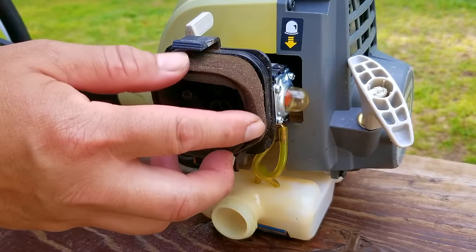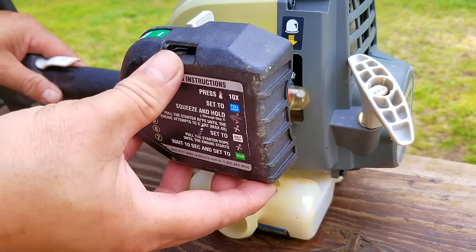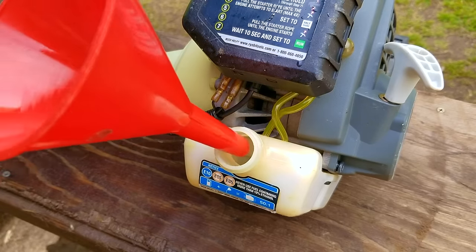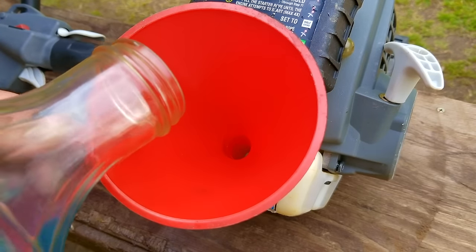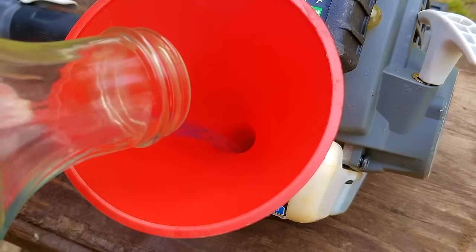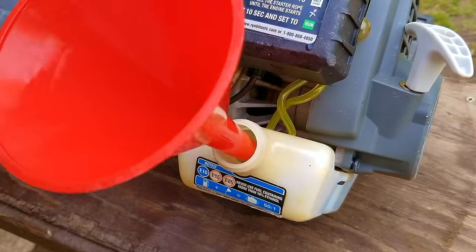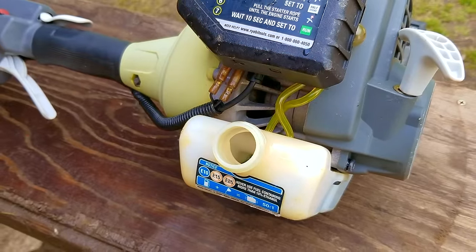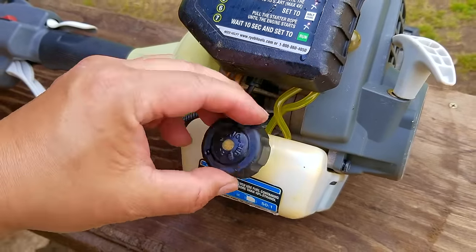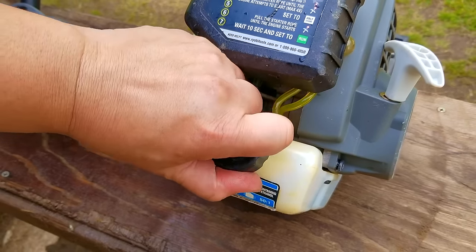The reason I know this is because about a decade ago, I made that mistake of swapping the lines on the carb, and when I went to use the trimmer, after about 10 minutes, I noticed that it started to act very strange, and eventually it stopped, and I couldn't get it to start again. After taking the carb apart, I saw that even though the inlet screen was clean before, it was now clogged with some interesting looking fibers. That's when I realized that I had the lines swapped on the carb and that the fibers must have been in the gasoline, which I never realized.